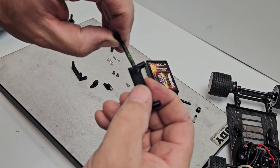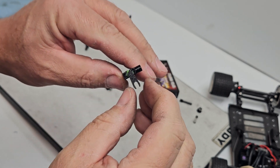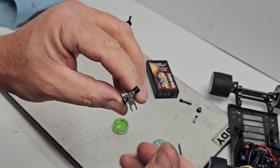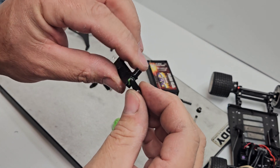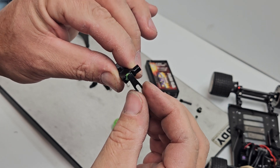Once you've got it on, just put the rod in there and push it down. You'll get a little bit of extra grease on the damper — you can clean that off before you install it. This super thick grease gets on everything, so my hands are covered in it and feel super sticky. But once the rod's inserted all the way, it's only got a limited movement, which is more than enough for what the car needs.